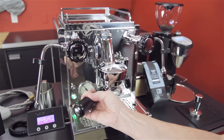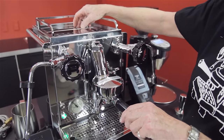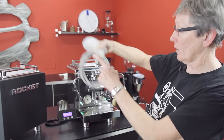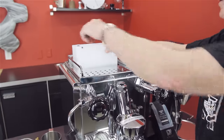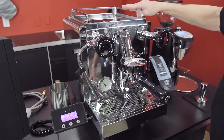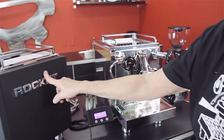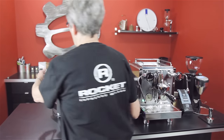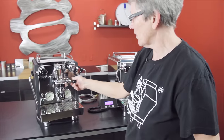We showed that in the unboxing of this machine in the previous video. It comes with the hosing and hose for plumbing in, and it comes with the drain hose as well. It has a water tank right back here, 84 ounces. Make sure you're using water with a little bit of minerals in it, because that's how it detects there's water in the tank — it reads the minerals. It comes with the metal cup rail up here, nice stainless steel casing. And if you don't want total stainless steel, it comes in black as well. Look at the Rocket logo on the back — individual raised letters, really nice. The black one is black sides, black back, and stainless drip tray and front.